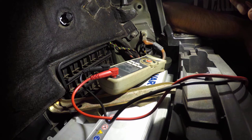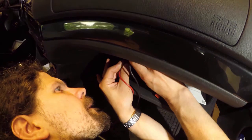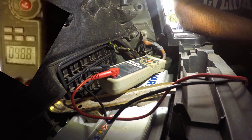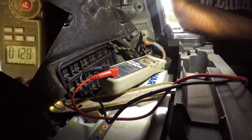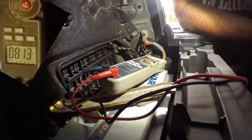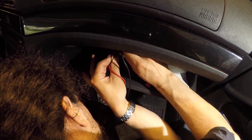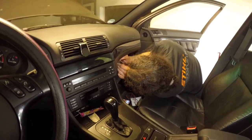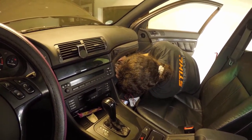Okay. Ooh, 1.9? 2. How much? Between 1.9 and 2. Too much. What did you pull out so far? Oh, something happened. Something major happened. It spiked and then it dropped. Whatever you did, it went to 0.7, then it went to 4.8, and now it's back down to 2. I think I will pull out 11 and 4 because it's simple. 11 is servotronic. But I heard a click,